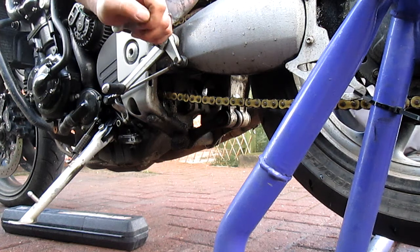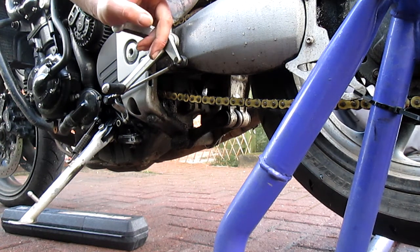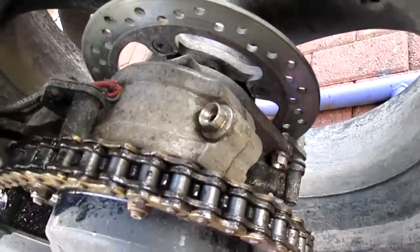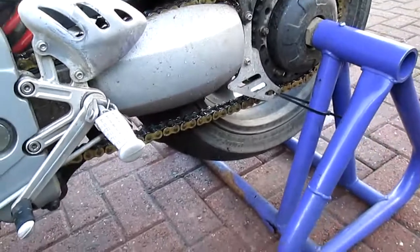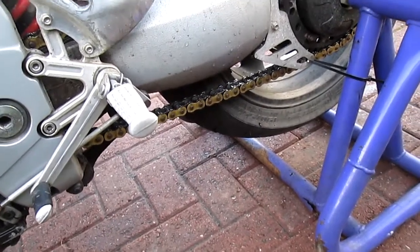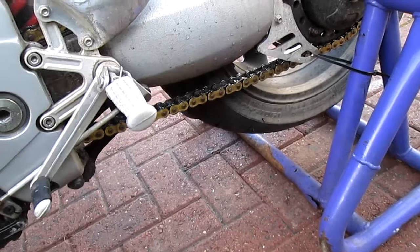Make sure it's cleaned and oiled, check it, spin the chain until you get to the tightest point, and then measure it at the tightest point. If it's too tight or too loose, just tighten or loosen it. This one is a single-sided swinging arm — there's only one bolt at the back. You've got a kind of ring, a cam, in the back. You undo that one bolt and then you can see the cam in there. You turn that cam and that tightens or loosens the chain depending on which way you turn it. I hope that's been useful. Pick a point and that's the measurement.